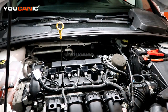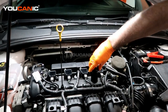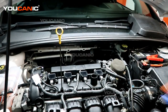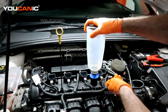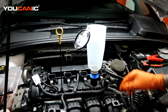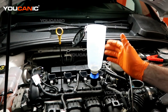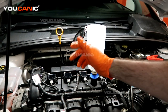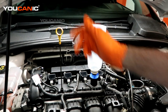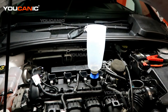Come back up top here to be able to add our oil. Use whatever funnel you like to get it in here. We're going to top this off to four and a half quarts, start the engine, check it, and check the oil to make sure that it's within our operating range.